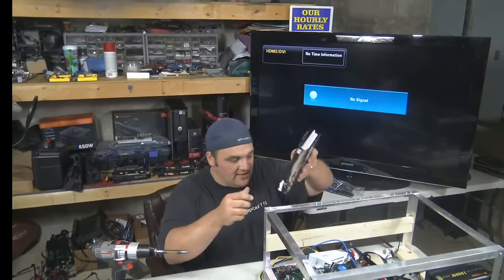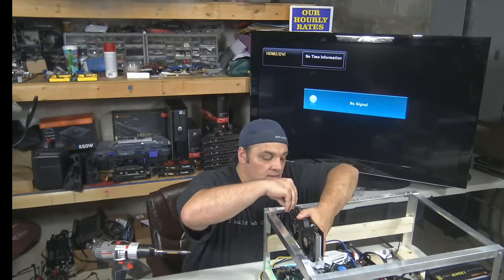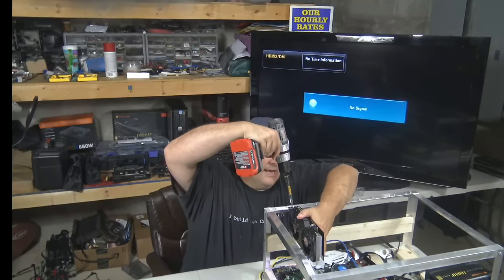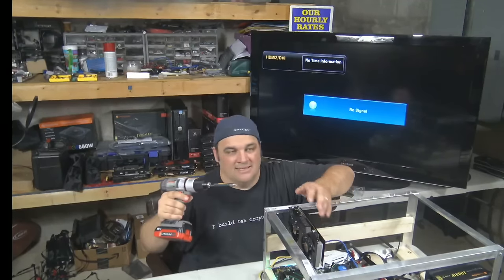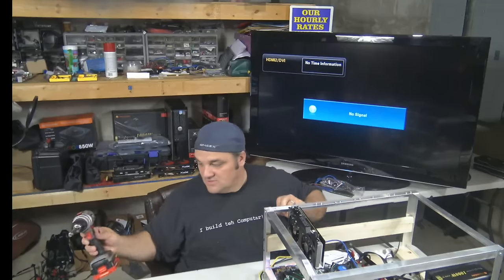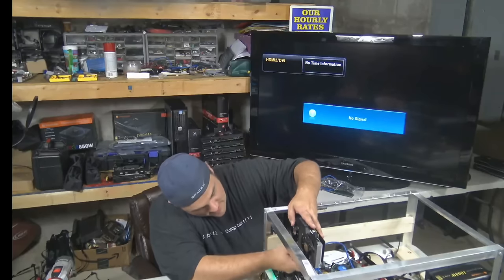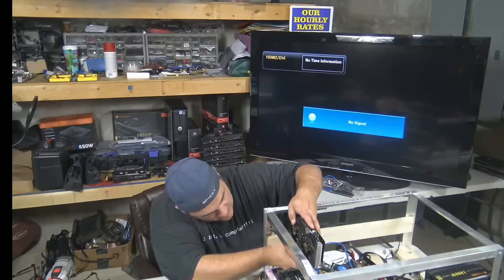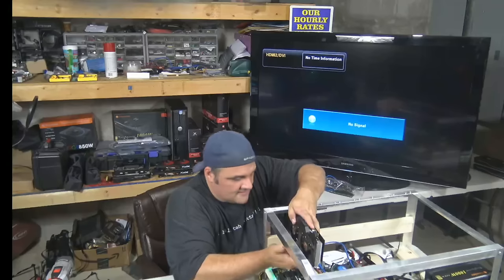So we're gonna do this 1070 or this 1060. Yeah, we had a server power supply. It was like a 2,000 watt HP and we had to use a converter on it. And that was more around the 390X days where you just had to use two power supplies, because they just used too much energy. A 1600 didn't cut it. We don't use any of the server power supplies anymore. We just don't need them. We don't need 2,000 watts of power at all. Maybe on an 8-card rig that's using a lot of juice.